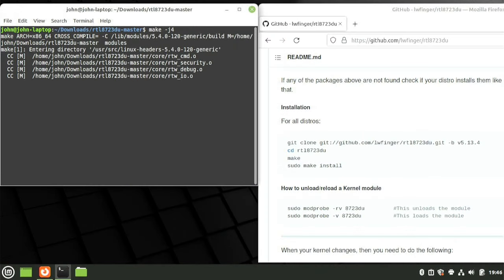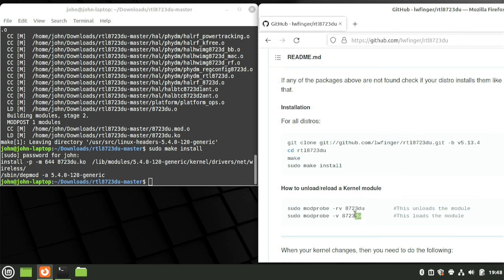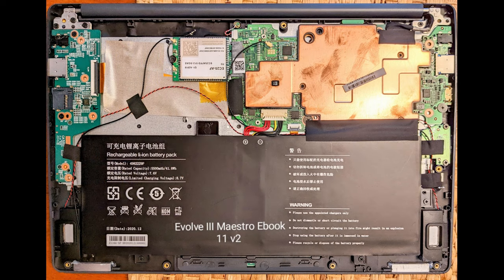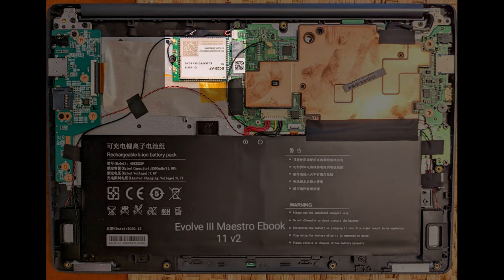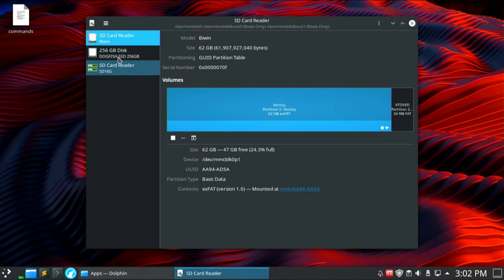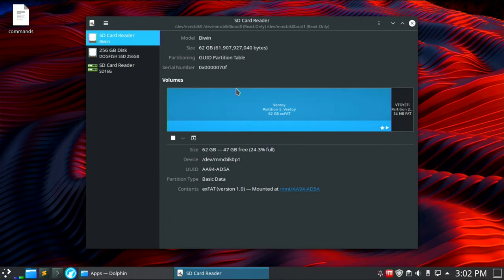I personally own the original version, and that's what I based the guide and the review on. Everything works flawlessly in Linux except for one catch: the Wi-Fi drivers need to be manually installed, but the process is very straightforward as I demonstrated in the guide, so this isn't a big deal. The original version also featured an LTE card with a SIM card slot, and a common upgrade was to replace the LTE card with an M.2 SATA SSD drive, allowing a second internal storage device much larger and faster than the built-in 64GB flash drive. I'll leave links in the description for some compatible drives.